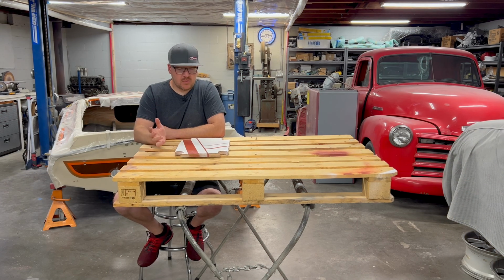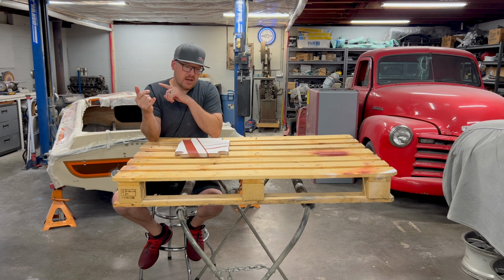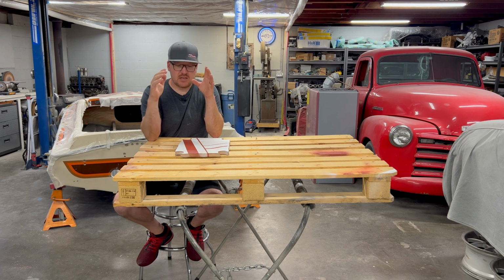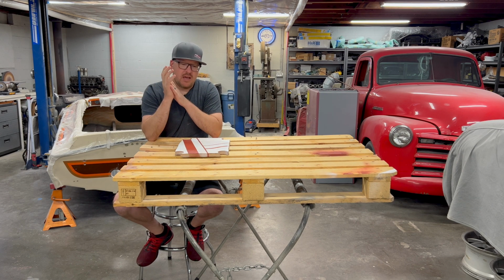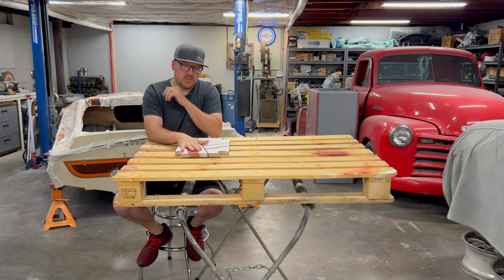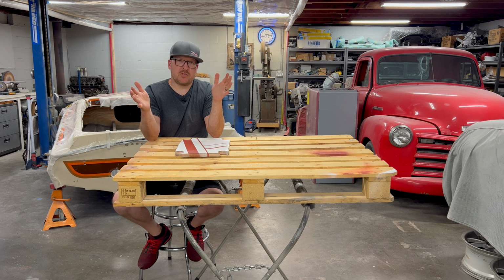Honestly, where I'm at right now, I'm kind of back to square one. I can go ahead and do the gel coat as I planned here, where I mask off the areas and kind of panel paint them each individually and remask everything, multiple layers of the masking tape in between each coat, and would be spraying gel coat that has the wax additive so it's cured and hard in between each time, and then sand down all 3 colors once they're all applied, polish them up.